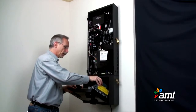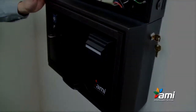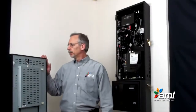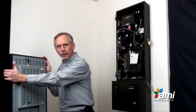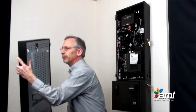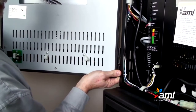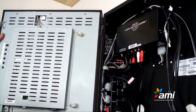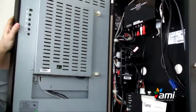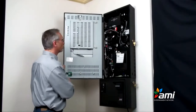The last step is to install the bill box and close up the currency module. The next step is to install the door — the door just slides on the two hinges on the cabinet, but there's a trick to lining it up. I always put my left hand on the top outside corner of the door and my right hand down by the hinge. When I lift the door, I'm able to steady the hinge and position it just above the pin, line up the top hinge, and start the top hinge first — it's a little longer and drops on just like that.